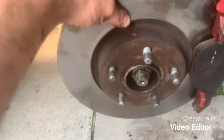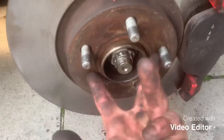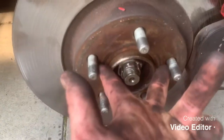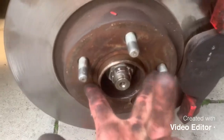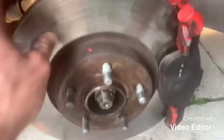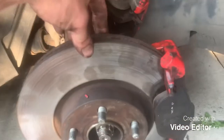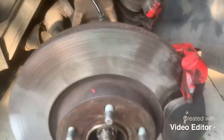These are floating discs. Some cars will have a couple of screws — fillet screws, allen key or torx bits — holding the disc in just to keep it in place. It's not really holding the pressure because the nuts and threads hold the disc, but look out for that if you're not on a Focus. On these they're just floating, so once we pull that mount off we can literally slide it straight off. I'll let you know what size bolts these are and the best tool to use.